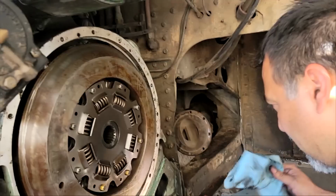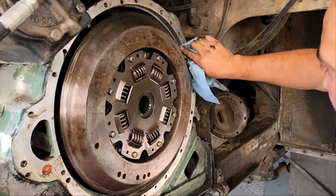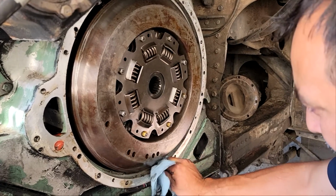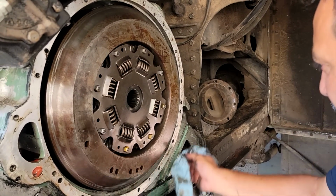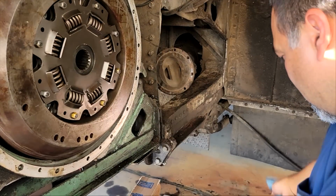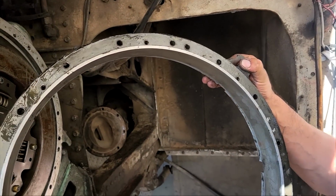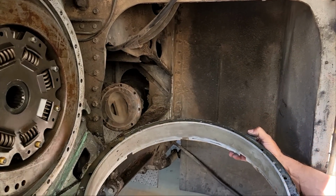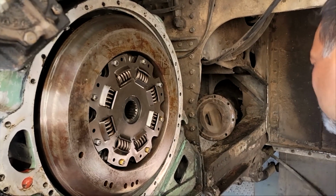So you really think that it's more this gasket that was the problem? Yep. Okay. So you think this area on the right hand side is probably the worst problem, yes? Right here. All along here. Can you look at the gasket where that is over there? Is it like torn? No, but it's all wet. Doesn't look torn. Is that also where those bolts weren't really tight? Yep. That we couldn't get to? Yeah. Yep. Okay. Fun.